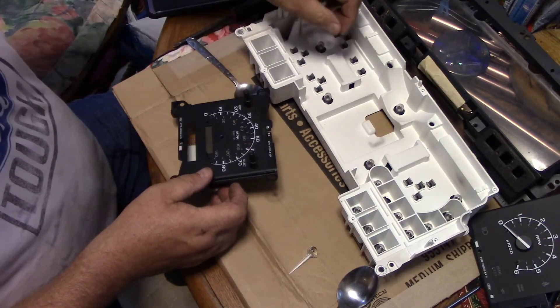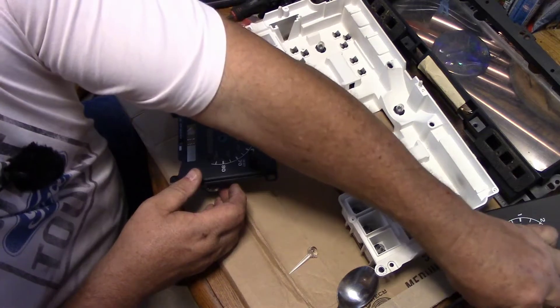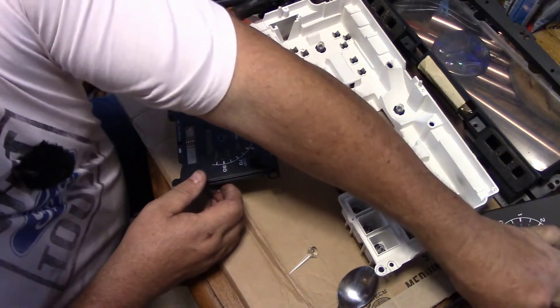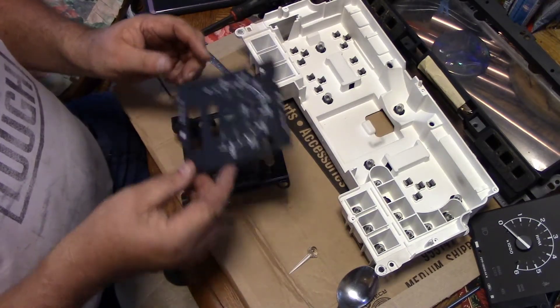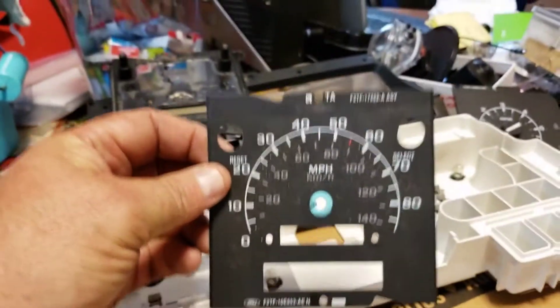You want to get under the needle - I picked this trick up when I replaced gauges in my '05 Mustang. Use a couple of spoons on either side and gently lever it, and it pops right off. I wanted to use this one first as a test because I don't need this gauge - I need the other one. Everything looks good on this side.